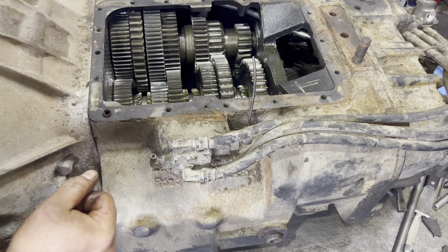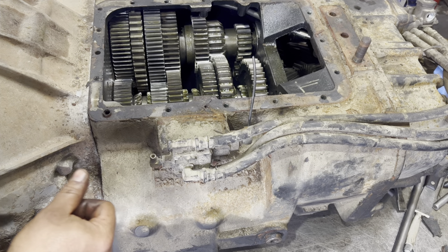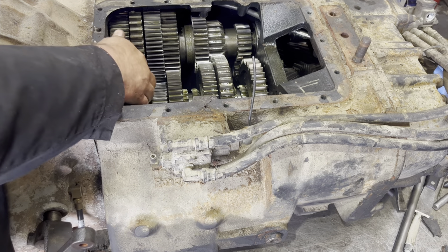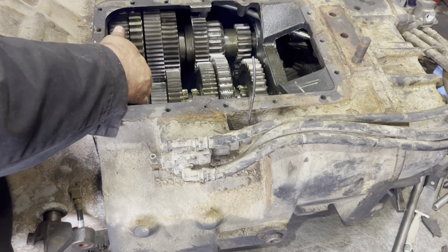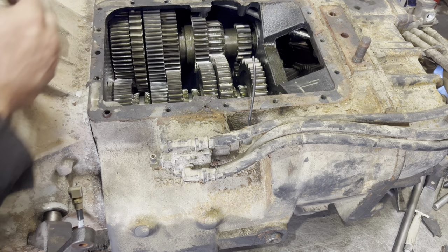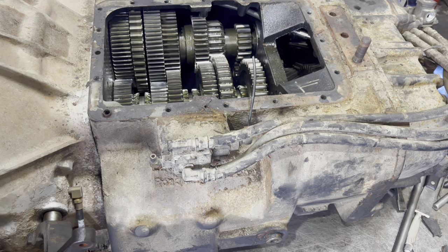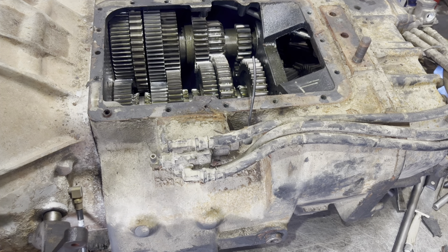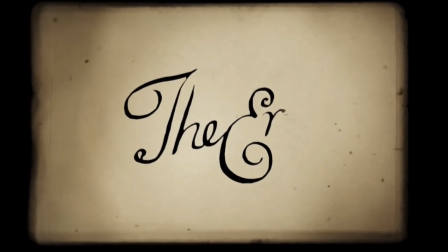It's like this when you mash the clutch down — that's why you've got to keep your clutch adjusted. People think that their transmission is bad because they hear the sound every time they mash the clutch in. It's your adjustment. Thank y'all very much for watching. Don't forget to like and subscribe, and keep your clutch adjusted if you want to maintain the life of your transmission.